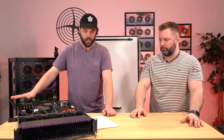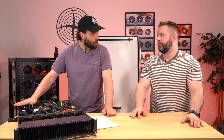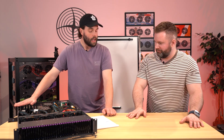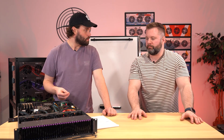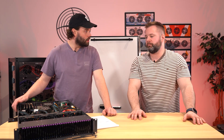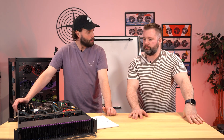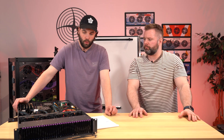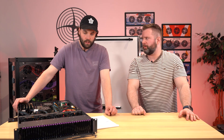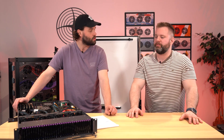The second gen only did SATA, but this one does NVMe drives. It also does SATA drives, and it also can do SAS. It can do that because it's built on the UBM specification — Universal Backplane Management. It's a specification mainly driven by Broadcom, adopted by others, and the whole point was to take NVMe out of the Wild West and make a standardized way of attaching a bunch of stuff into a server.